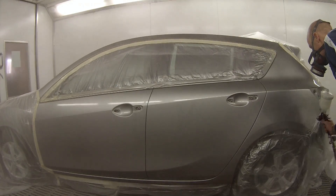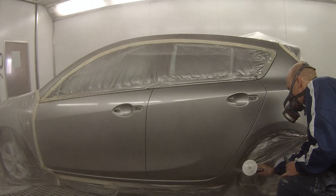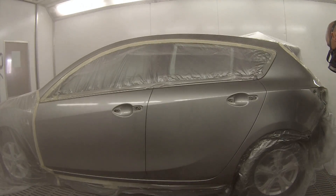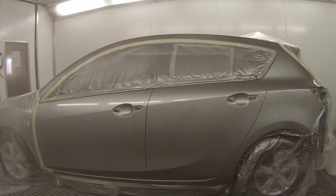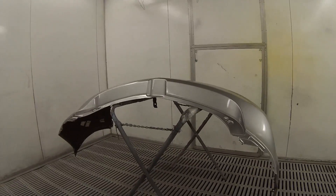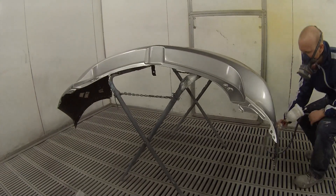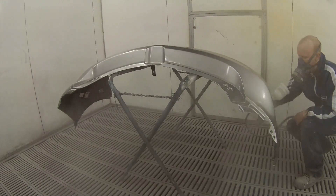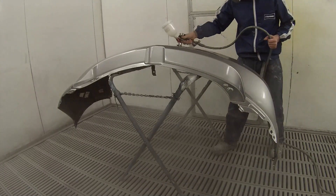Always paint through those door gaps. You can see how I'm finishing halfway through the quarter panel instead of finishing right at the door gap. If I had done my stopping section at the actual door gap for both coats, you can end up doubling up if you're not careful and you start getting big build-ups and paint running across those door gaps. So always paint through them.